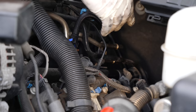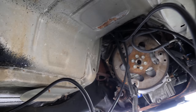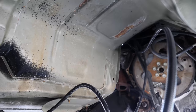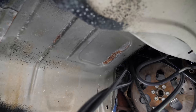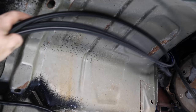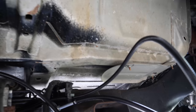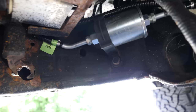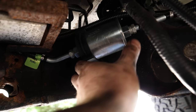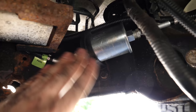Now we get everything fished through. I got the snakes in place and they have some good laying to them. Once the transmission is in place I can tie them together and secure them to the fuel line bracket that bolts to the top of the transmission, then clip them up and run them down here — maybe put something right into the frame to hold them — and make sure nothing rubs on the transfer case. Unfortunately the fuel filter fits a little bit weird the way this line comes out; I can't get it centered on the bracket. I might just re-drill the holes, move it over, or use self-tappers and a P-clamp to add an extra strap.